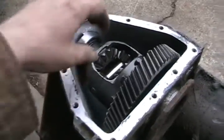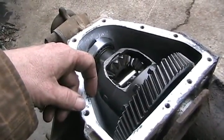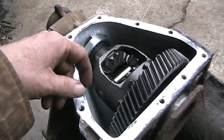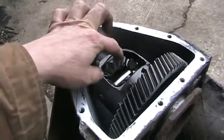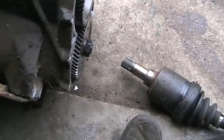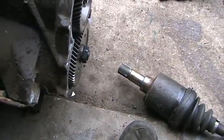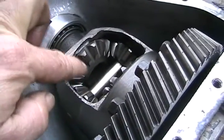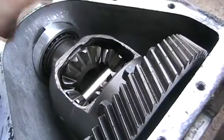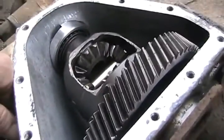If this were a standard transmission, this part would be exactly the same. If you're abusing the transmission — like having one wheel locked up with good traction and the other one on ice or in the air spinning extremely fast — sometimes this gear cluster can explode. If it's a standard transmission and you're really popping the clutch hard and trying to get one-wheel peel smoking the tires around corners, all the torque on the splines inside those spider gears can cause the spider gears to split. Then of course this all explodes, and it sends so many chunks around that usually the whole transmission is destroyed.